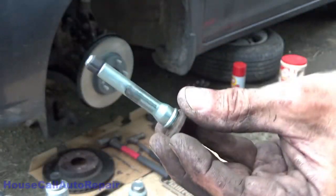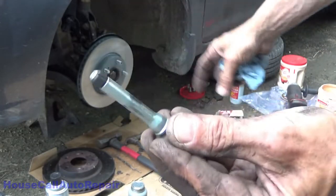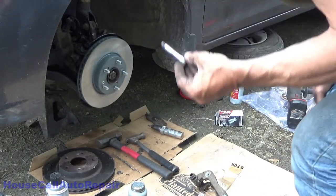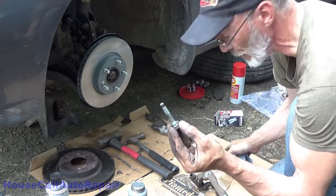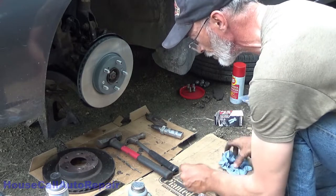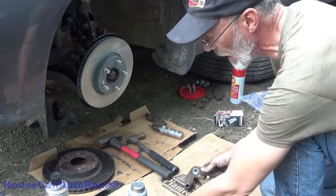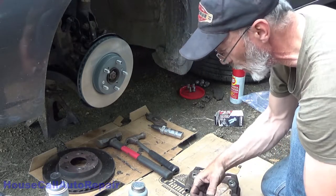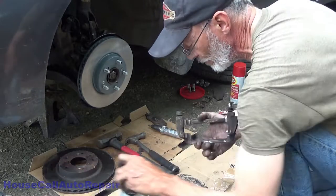This is why we pay all the attention to the caliper bracket. This is the whole brake job right here, basically. This is the most important part. And if your mechanic is not doing this for you, they're robbing you. And it does not mean pull it out, stick new grease on it, and shove it back in there. No. You take it out, clean it out.